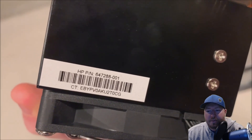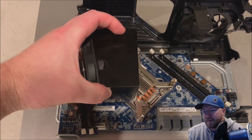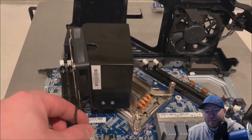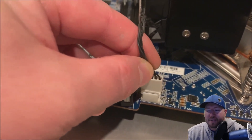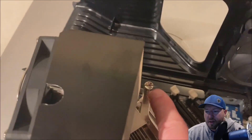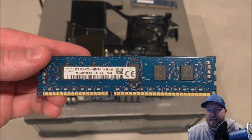All right, here's our heatsink and fan combo — it's kind of an obscure-looking heatsink kit but it fits perfectly on this riser board. It mounts like so. There are four T15 screws we're going to have to tighten, as well as we do have to plug in the fan to the riser board so that the fan can keep that CPU cool. The fourth screw is actually right in the middle of the heatsink and you'll want to use a T15 or a thin flathead to tighten those.